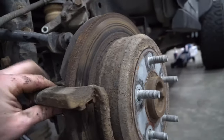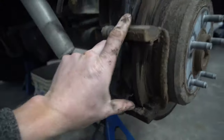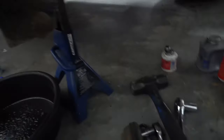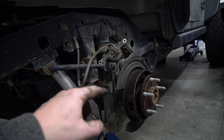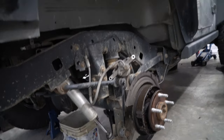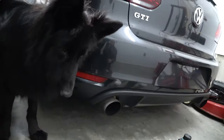Now that we have both screws loose — and look, another brake clip. Just take out those two bolts and put the bracket off to the side. Another tip: if you have your box wrench on and you can't get it loose, take your hammer and hit the box wrench — keep your hands clear so you don't smash them. Make sure you disengage your parking brake before you start taking the rotors off.